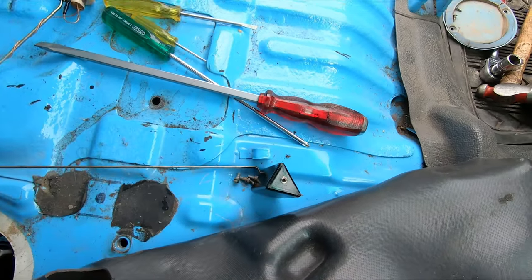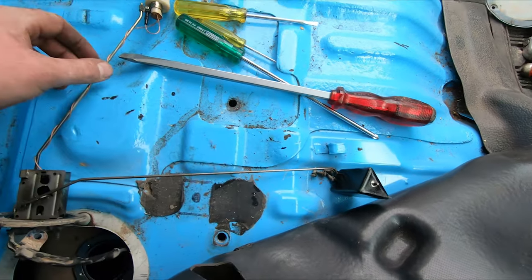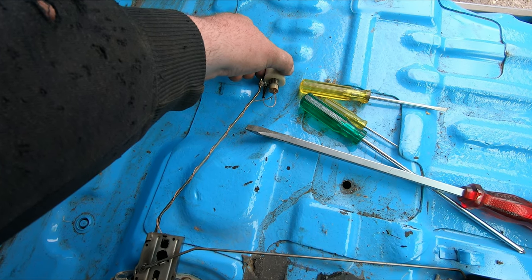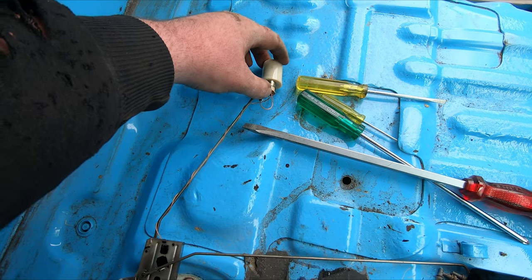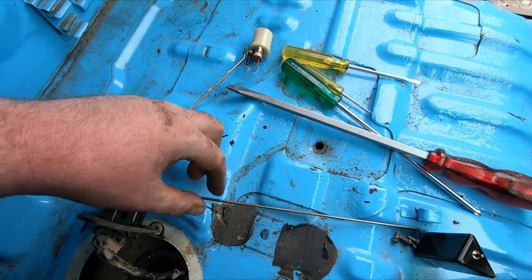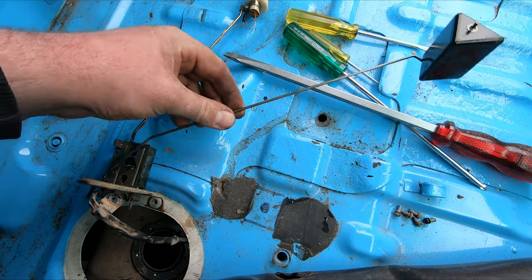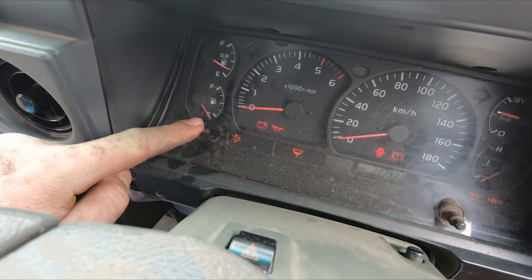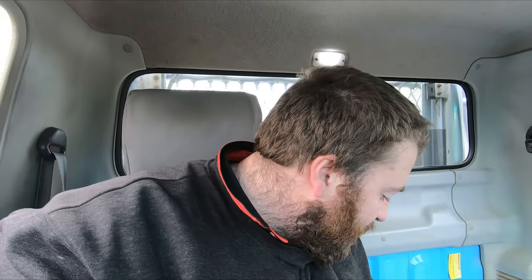So here's the float — this little black plastic container, little float. And then here is the low fuel light sensor that earths out to make a light come on on the dash, which doesn't seem to work at the moment — I don't know if it has to be in the tank to work. I've got it sitting at the full mark right now; that arm pivots and as it sits there, that's at full. You can see on my dash the primary tank is still reading empty. It feels a little bit crunchy — I don't know if it's spring loaded inside the sender unit, but it just doesn't feel right compared to other ones I've felt before.